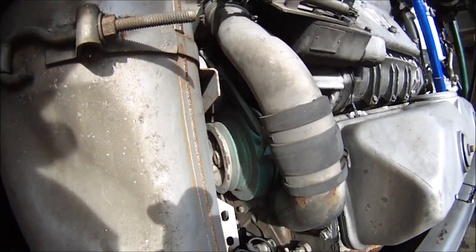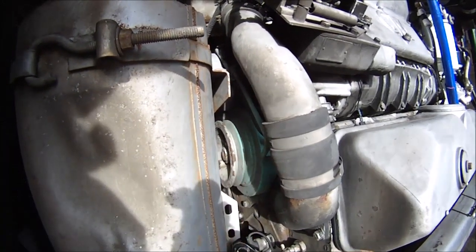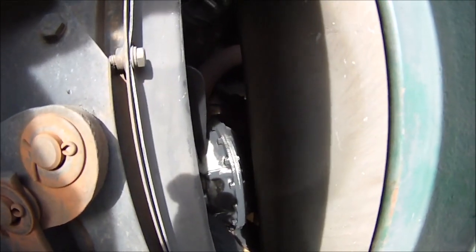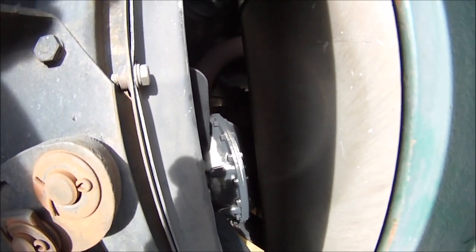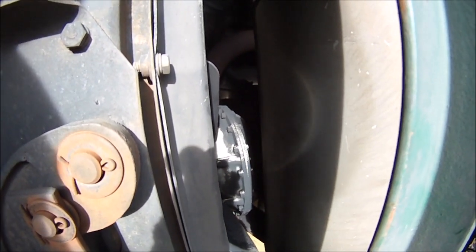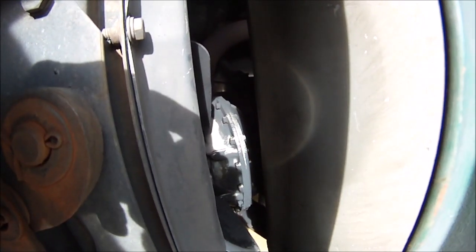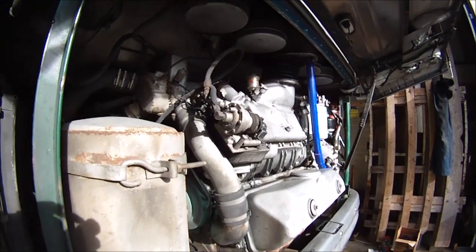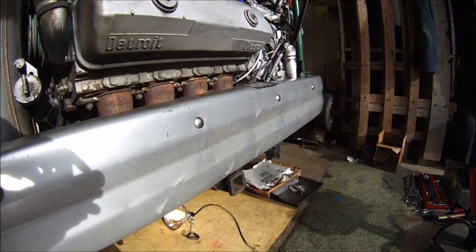This harmonic pulley has a seal that occasionally leaks — I've taken that out and replaced it. You take the muffler off and put a puller on the harmonic pulley, pull it off, and just snap out the seal. One thing that always leaks is this fan drive. The fan drive is two halves of an oil-driven drive, and it leaks no matter what you do — no matter how tight you make those bolts. There are oil passages between the two halves and you can never get it tight enough to keep oil from pushing out, so they're constantly wet. But as bad as that looks, it's only maybe once every ten times I park that I'll leave a drop on the ground, so it's not too bad. You do have to stay after it to keep everything tight and keep everything from leaking to hopefully keep oil off the back of your bus.